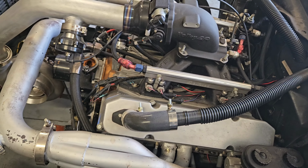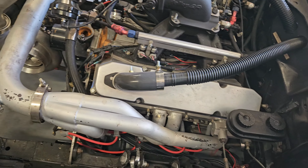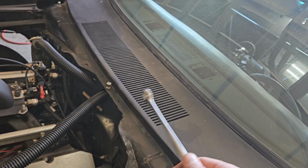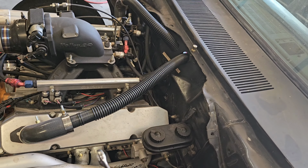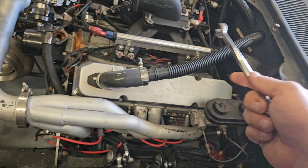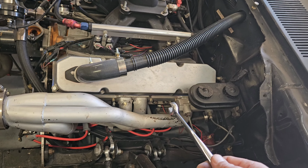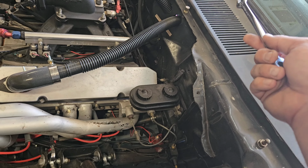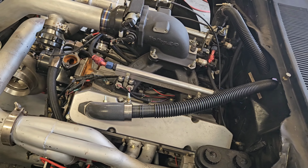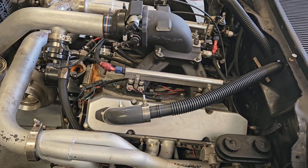So get these off, probably pull off the bumper, the grill, then the turbo kit, and then we'll jack her up, get the drive shaft, shifter cable, transmission lines. We'll drain the engine and the transmission, take off the intake, the wires, take off the starter, and then we got 4 transmission crossmember bolts, 2 mid plate bolts, 2 motor plate bolts, and that's it. And she should come out. The time now is 12:30. I'm hoping to be done by like 4.